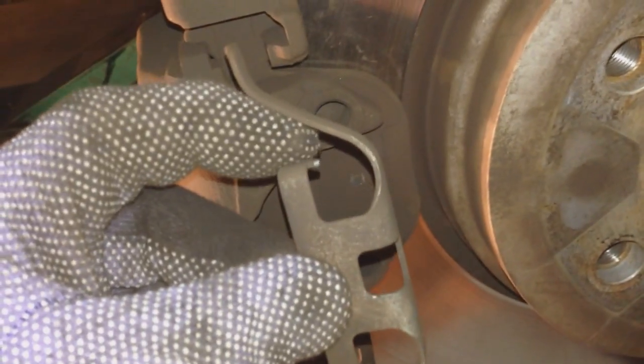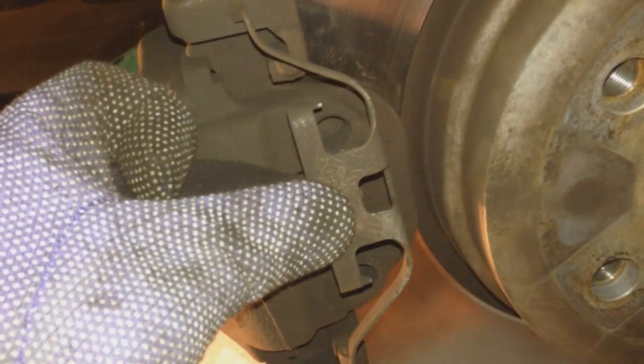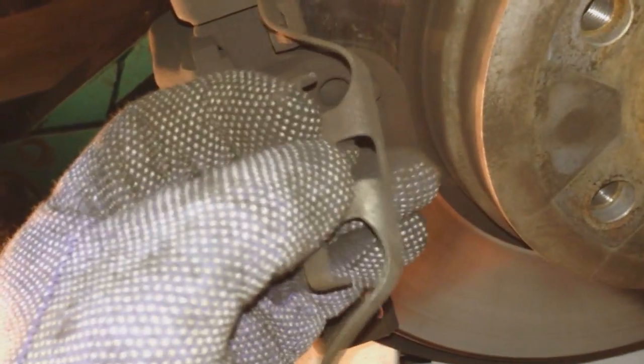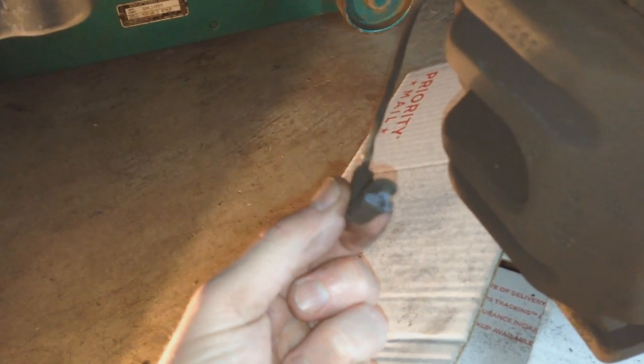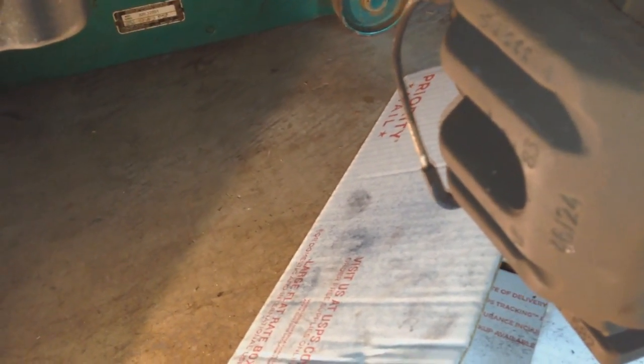On the side of the caliper you'll have a little spring system hooked in with tabs into holes. To remove it, I just grabbed my channel locks, put them on the back of the caliper, squeezed through this little section and it pops right out. Or you can grab a flat head screwdriver and push the spring backwards toward the rear of the car. We also have our two 18mm bolts out with little washers on the end — those are the caliper bolts. If you don't want any dash lights on, order brake pads with the sensor, and order the sensor separately if needed. Links are in the description box below.